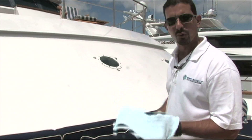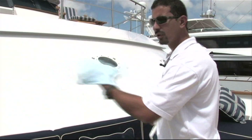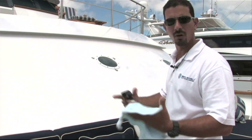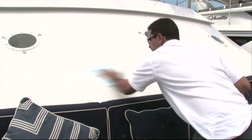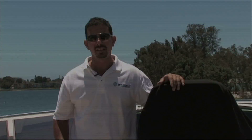What will scratch your paint is grit. If the surface has a lot of grit and you're picking it up in your microfiber, yes, that could scratch the surface. Microfibers come in packs of 50 — the idea is that you don't use one towel until it's dirty; you keep rotating and washing them. Keep your towel clean, spray a little bit on the towel, and apply. If you feel comfortable, you can spray a little onto the surface — you don't need much — and just spread it around. You can feel it's nice and smooth. Find more information about our products at www.sea-shield.com — that's S-E-A-S-H-I-E-L-D.com.